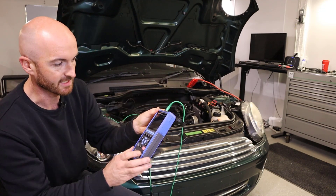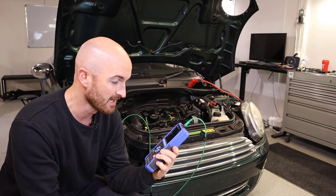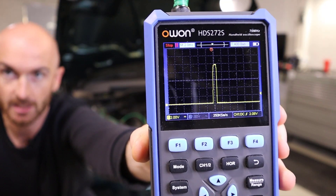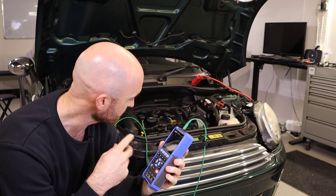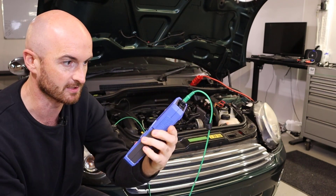What we can see there is basically a pulse — about 10 to 15 pulses — constantly going out, a very, very small pulse. The reason it's a very small pulse is because if there's a short circuit and it's pulsing for that long, it's not going to set any wires on fire or anything like that.